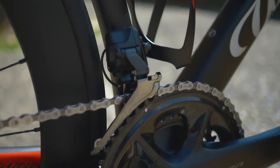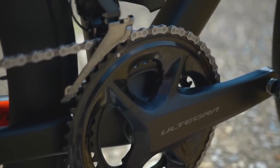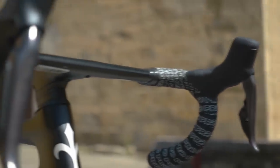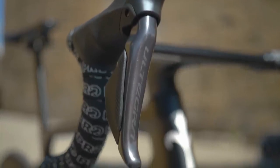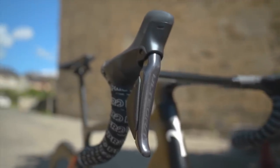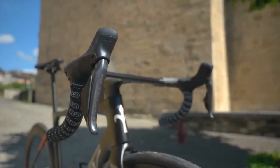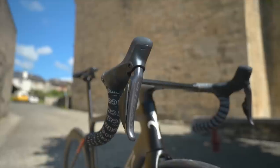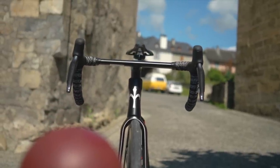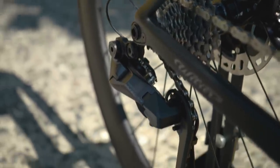That's a difficult one, because I'm too much engaged already in all the developments, so maybe too close to it. Not the right one for me to answer. For me, I've always wondered when we go to internal hub gears, or in a frame, like a really small compact system and no derailleurs hanging off a frame, but that doesn't seem to be realistic. In general, integration, I think, is a general market trend that we see. Yeah. And maybe not driven completely from pure road cycling, but what you see happening on the e-bike side, also on e-road and e-mountain bike and sportive bikes, how fast frame makers and bike makers are now moving towards integration, I think you can expect that will be driving any future generation of components and bikes.